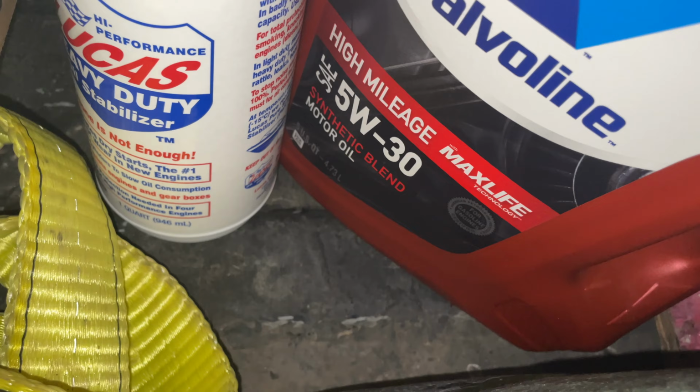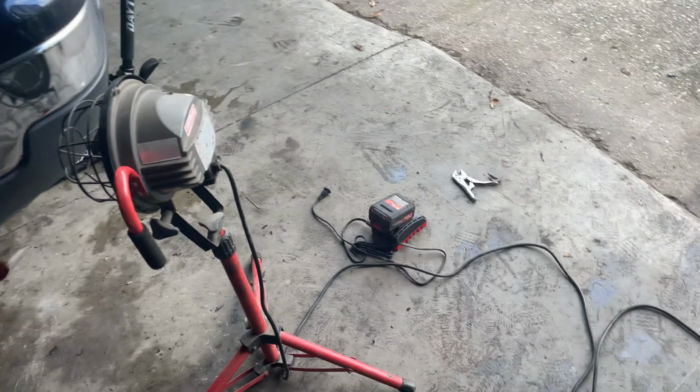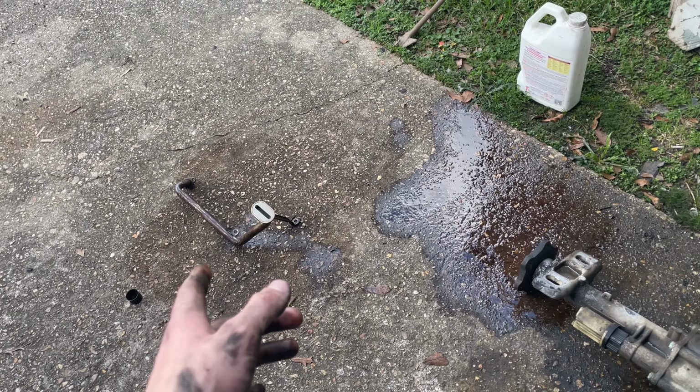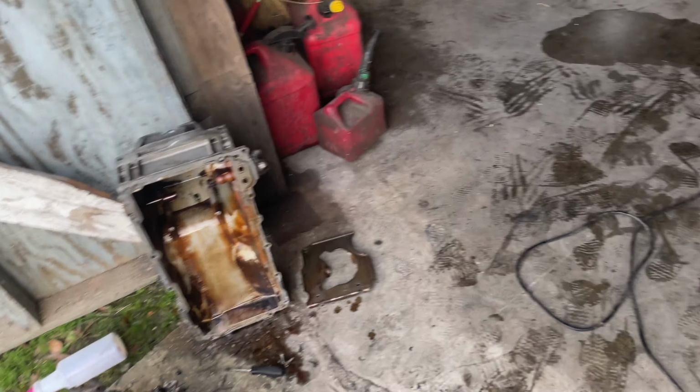I've got the high mileage. And then I'm gonna put this quart in there, and hopefully it fixes my lifter issue. It ticks when it wants to. I'm just trying to eliminate one thing at a time. If this doesn't fix the problem with me changing the O-ring and cleaning that little filter out and everything,